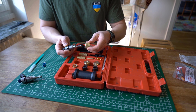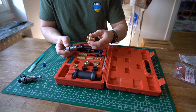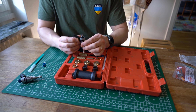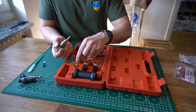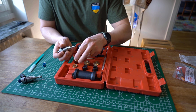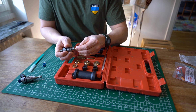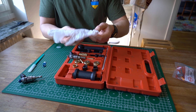The idea is you push the Teflon seal across the cone and then use these tools to gradually make the Teflon seal smaller so it fits better. The final seal will be made once you install the injector into the cylinder head. Through trial and error I found it was better to use my hand and apply even pressure to slide the seal across, rather than using tool number one. I'll put on a latex glove to do that.